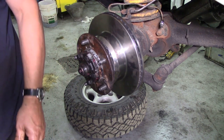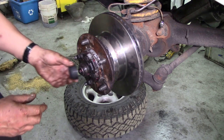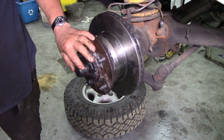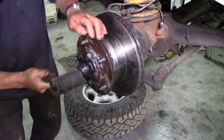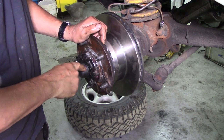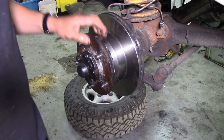Take your special shaft tool out. These are all different threads but a 7/16th UNF works. Next, put a bit of grease in the cap and force it on. These can be bloody tight - I'll use a rubber mallet to put that on. When they're too tight they're going to eventually split because it's rubber and plastic type material and it's not going to last all that long.